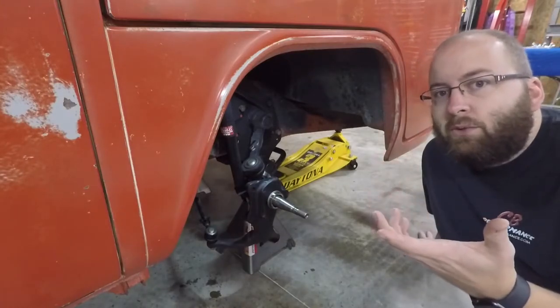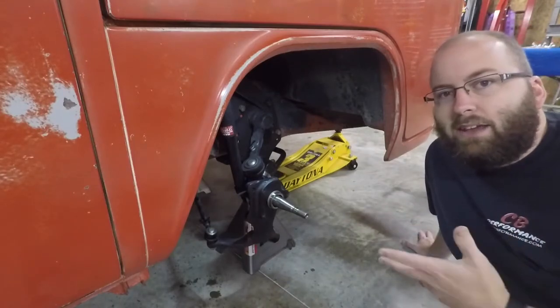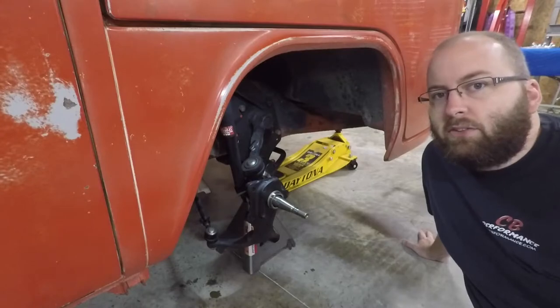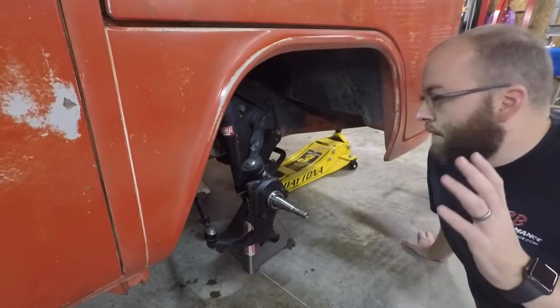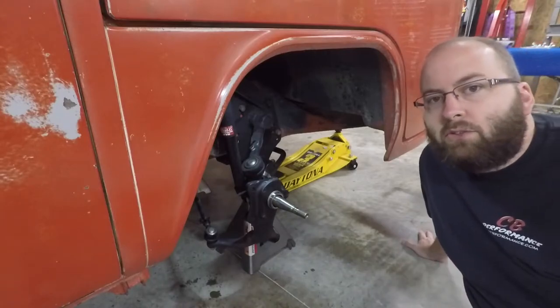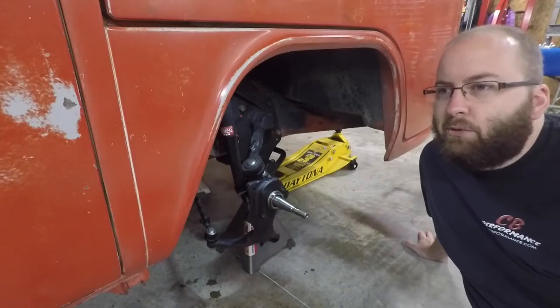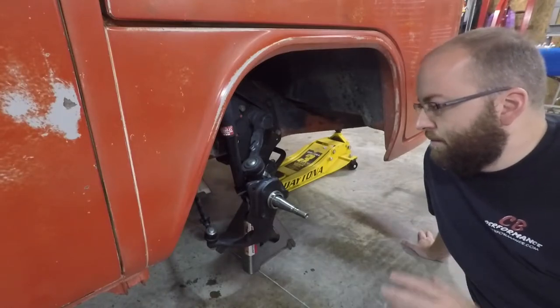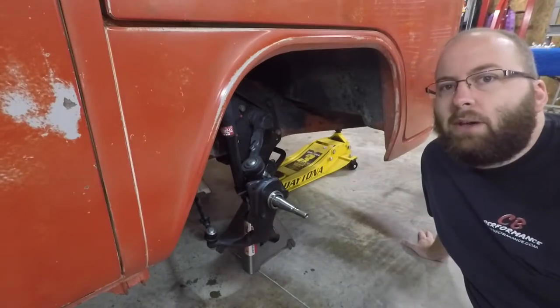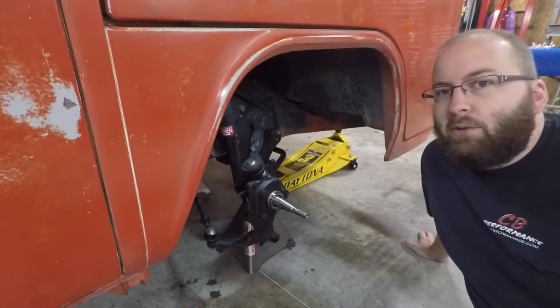So one of the other things that I like to recommend in a situation like this is, when you get stuff pulled apart, go ahead and take a visual inspection of everything, see how everything is working for you. I'm basically running a full Wagons West front suspension here. I've got a 4-inch narrow beam and 2.5-inch welded drop spindles. I've had all this suspension on this bus now for about 2.5 years or so. Fantastic parts. I'd highly recommend hitting up Nate at Wagons West if you're looking to lower your bus. Quality is hard to beat out of his stuff.